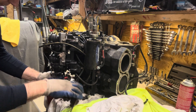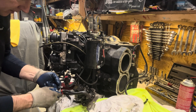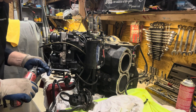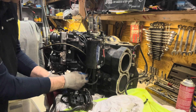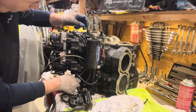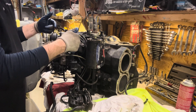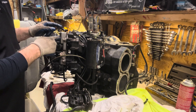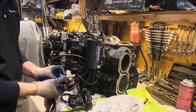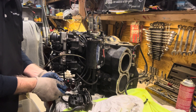So now we can access some of our tubing for our pump and disconnect some of that. This was connected to my primer, as you can see — it just pulled right out, so that wasn't a very good connection. The primer tubing goes up and feeds into a T that feeds two of our carburetors, then feeds over to the opposite side to another T. So it injects that fuel right at the base of the plate, after the carburetors. When you turn the key on and push it in, it energizes — this is what the purple wire gets, that's why this has to be grounded. So this gets power and it injects. You can override it manually, but you certainly don't want to leave it that way, and sometimes these leak.